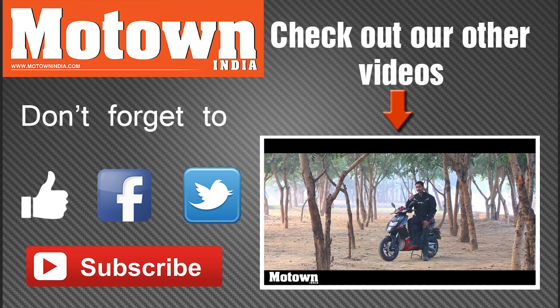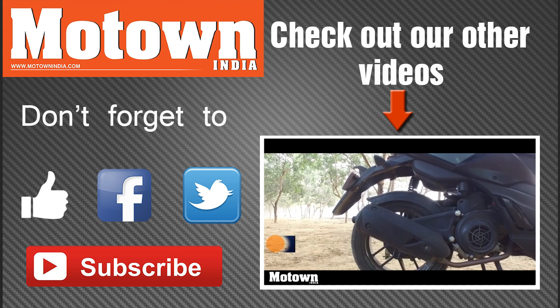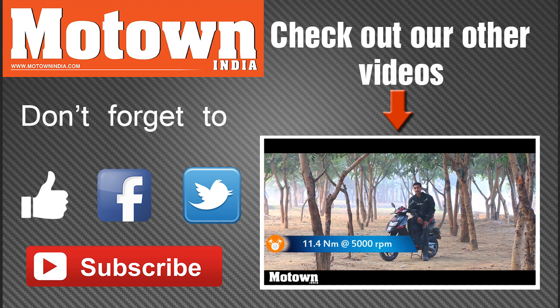The best way that I can describe the performance of the SR150 is by calling it an agile leopard. This 150cc engine puts out 11.4 Newton meters at 5,000 RPM and 10.4 horsepower at 6,750 RPM.